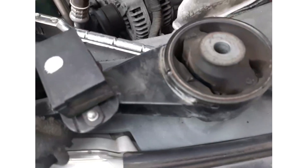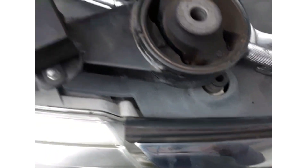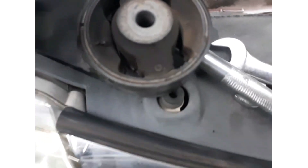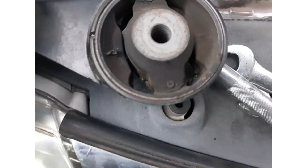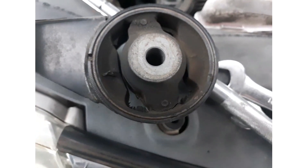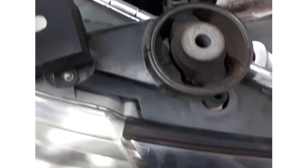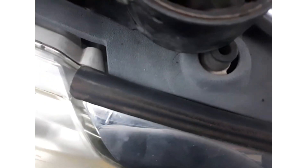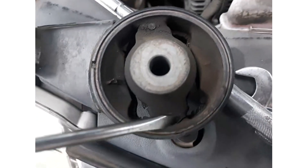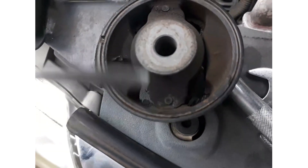Physical inspection to see what the likely problem could be. Since the complaint is hearing some clunking noise — if you look closely, you can see this bushing is torn on this side. There's a deformation of this bushing; it's been ripped apart. Take a screwdriver and see the extent of the damage to get a deeper understanding of why you've been hearing that clunking noise. You can see it's practically torn — it has a big tear right there.